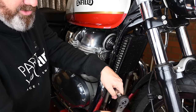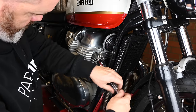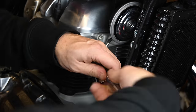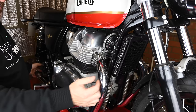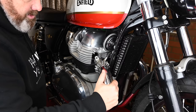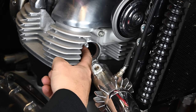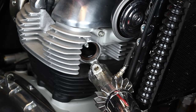Using the long arm gives that little bit of extra reach. We will reuse these nuts. With those undone, we can slide the header off the end. Now there's much easier access to the O2 sensor. We then need to fish out the crush washer, put the new one in from the kit, and get the new header on.